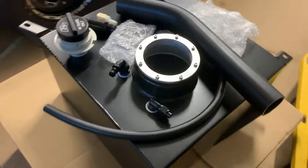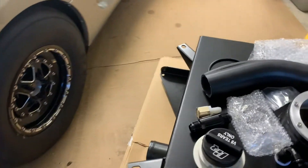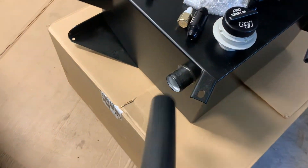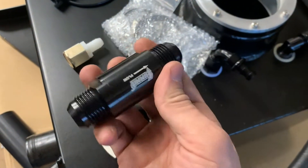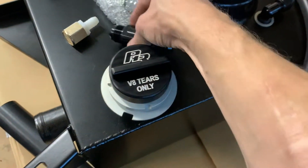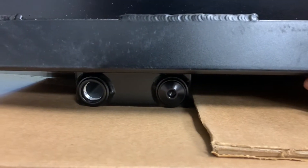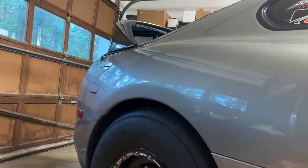Powerhouse Racing sent me this. As you can see, this is a fuel tank. What this does is replace the OEM tank. It will use the gas door that you normally use to fill up. They give you this awesome new gas cap. We got a check valve, which you will need in order to run a primer pump, a vent filter, a couple fittings, and plugs. Basically what happens is the fuel will now be picked up for the mechanical pump from the bottom of this tank from the back. So even when you're accelerating, all the fuel is actually going to be going here instead of away from the pump like it probably is right now.